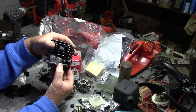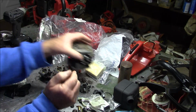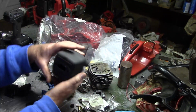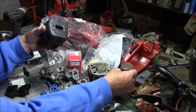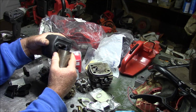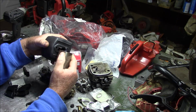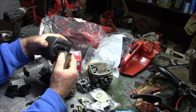They're now somewhat closed by the piston, plus there's a sharp square edge of that piston. You know, imagine this muffler, imagine that being the transfer. Imagine this being the piston at bottom dead center. It comes down here. It wants the transfer port to be wide open, but now you move the cylinder down. So now your piston's here. It didn't change, but your transfer port is quite a bit closed off.